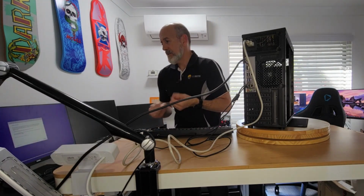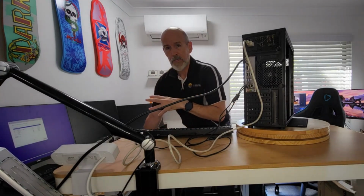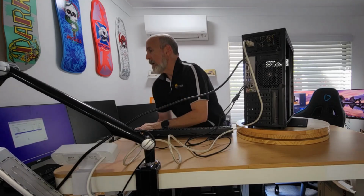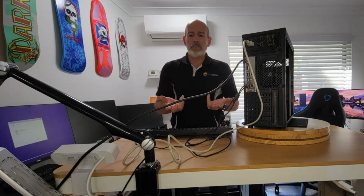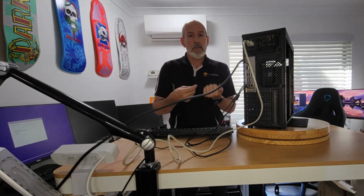And installing Windows 11 and 10 is so much quicker. I don't have a product key. I do, but I never put it in until I've got everything installed. Just in the 11 Pro, in the off chance that there's a problem with, say, the motherboard, I would like to do a bit of a burn-in test first, because it would really be annoying if you put your key in, it activated, and then something's wrong with the motherboard. So you've got to RMA and get another one.